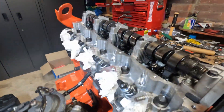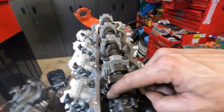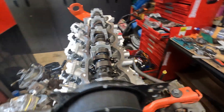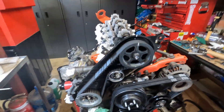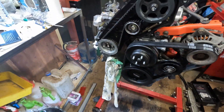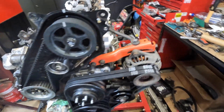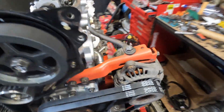For cylinder one it looks right about where I want it. What you want is the smooth side of the cam to be touching the valves - you don't want the valves to be engaging at all. I've also put on the thermostat and thermostat housing. I've put on the support bracket for the alternator and the idle pulley, and painted it orange - though it looks rough because the alternator scratched it up. But now it's time for valve clearances.